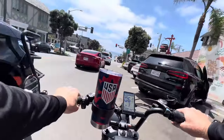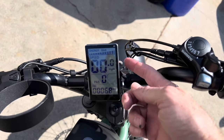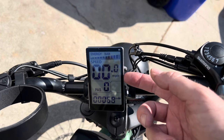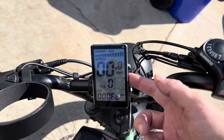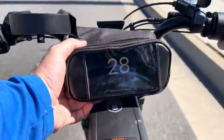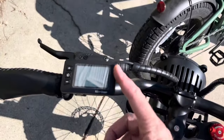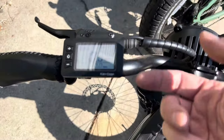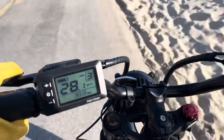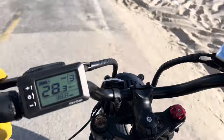In addition to a cup holder, the Ape Rider has a basic M5 controller. There's no way to unlock it to go more than 20 mph other than setting it so the bike thinks the wheel is a smaller diameter — I set it to a 5-inch diameter and it'll go super fast, though the speedometer reads off. On GPS, the max speed is 28 miles an hour on the Ape Rider Bonobo. The Rave Bullet GT has a KD display controller that can be unlocked very easily — I made a separate video on how to do it — and it also hits 28 miles an hour, just a little over 28.5 on my speed run.